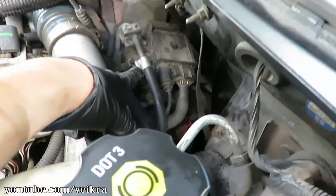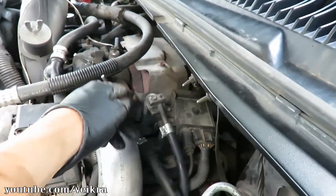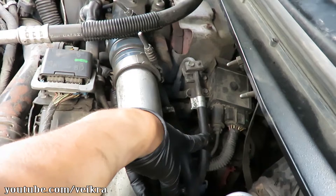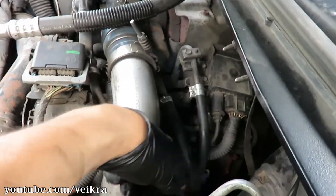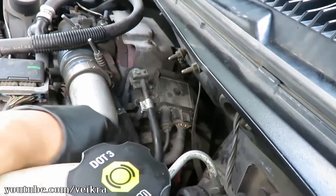On the other side here you'll need to cut the barbs because it's kind of a pressed-on connection. These were mine that were the worst — they were pretty much closed down from vacuum. This one was the return. So these two need to be replaced and they go to the metal line running up right there — they plug from the engine all the way there.